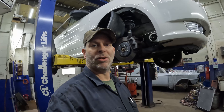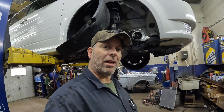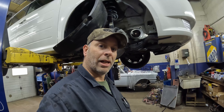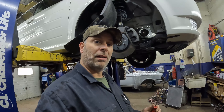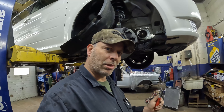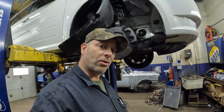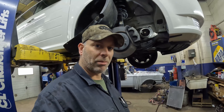Another day in the shop. We got a 2011 Ford Flex, this is a 3.5 V6. We actively have a water pump leaking here. I just want to show you guys what to look for, where to look for drips with these water pumps. The pumps are internal, driven off the timing chain. They have a channel that runs outside the block, kind of behind the alternator. I'll get you in here and show you where the drips are coming from and what to look for to diagnose a water pump on one of these.